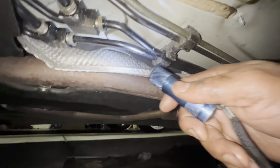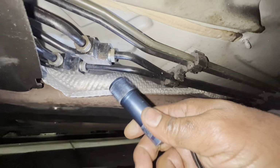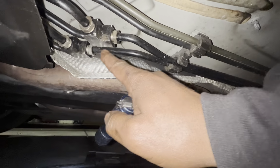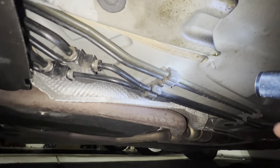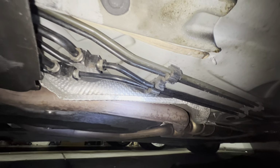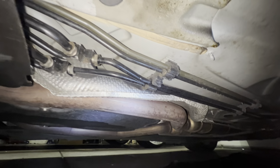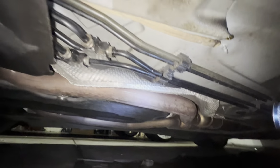These lines right here obviously go to the ABC suspension, and they go right here to this connection here and here. You have to disconnect this line from this in order to drop this line all the way down. Of course, the rear valve block has to be disassembled, and that line connects to that. So those lines, typically people need those. They will rupture on the backside where there is a rubber joint.